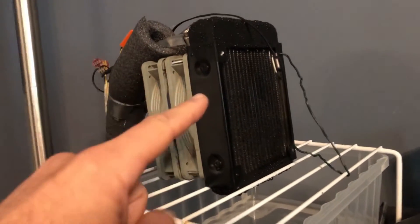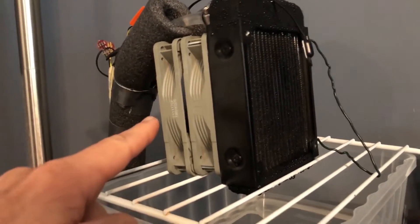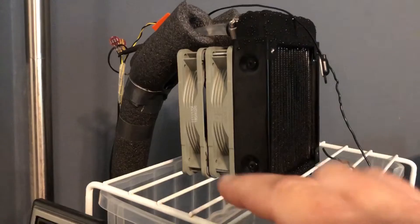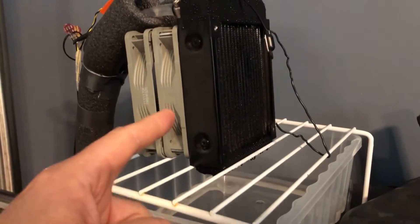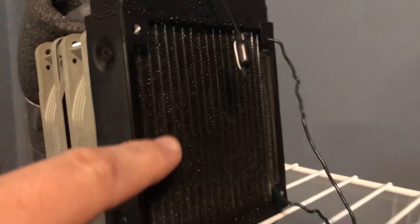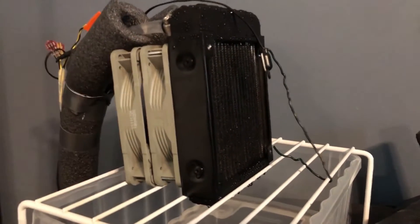All this is using here is a 120-millimeter heat exchanger or radiator for a computer case, and then two Noctua fans. I don't know the exact model offhand, but these are the 1700 RPM model and they push about 2.93 millimeters of water. You can use just one fan, but it won't move enough air through this heat exchanger because the holes between all the little slots are so small it takes a little bit more pressure, so you need to double up the fans if you want this to put out more air.